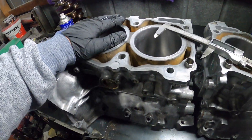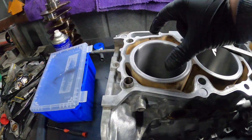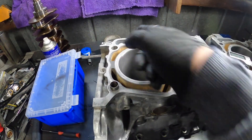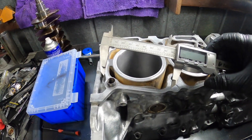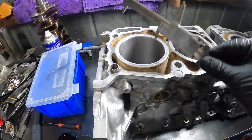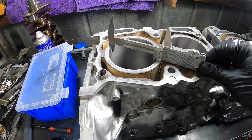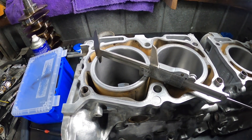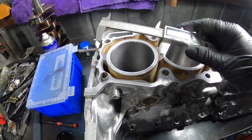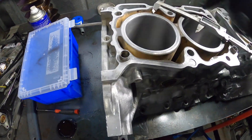I've just been honing this one out. We've got the scrapes on both sides. Let's see where it is. Normally where the STI bracing would be — just use the vernier. I went around and I don't think these are round anymore. I need to get some micrometers to make sure that's correct. I don't think I'm going to do anything further to this block just yet.